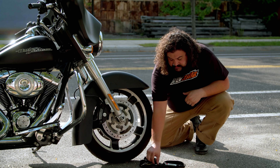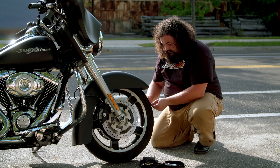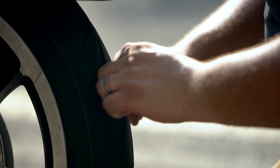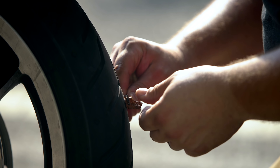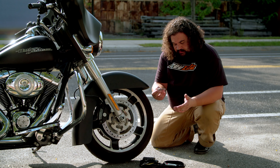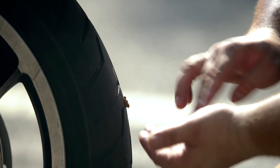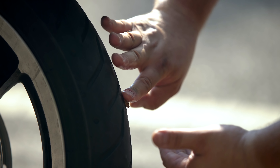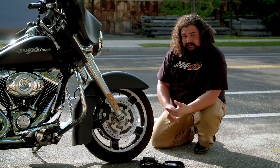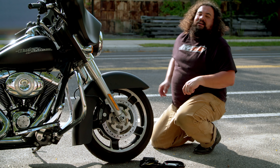We're almost home free. All we have to do now is take our razor blade and trim the plug flush with the tread. The reason we trim it flush is so the roadway itself can't grab this gummy plug and pull it out. There we go — get rid of that piece. Now if you want, do one last check: use a little spit to check your work. I don't see any air bubbles, so I think we're set. Button up your tools and make sure the item you pulled out of the tire isn't in your tire's path.